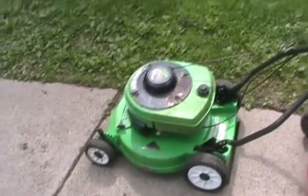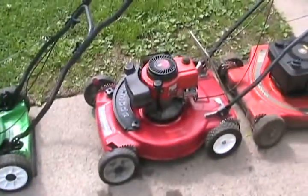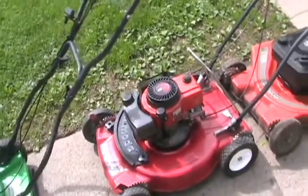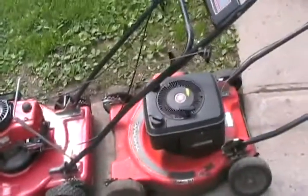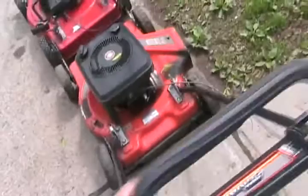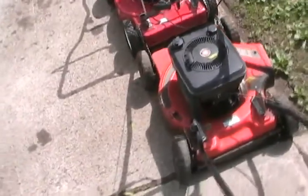Working my way right along fixing up all that stuff I garbage picked on Sunday night and Monday night in my neighborhood area. That one was the throttle cable which did the choke and the magneto — no spark. This one was all disassembled for some reason but really didn't have anything wrong except water in the gas tank, water in the carburetor, water in the combustion chamber. After getting all the water cleared out, runs great. This old '86 Quantum — the only thing wrong was the wheels are totally floppy because it's got crappy adjusters, but all I did was dump the old gas, put fresh gas in it, fired right up.